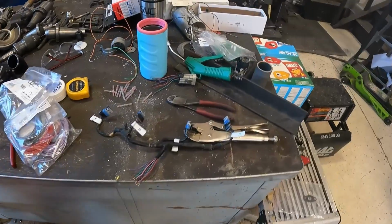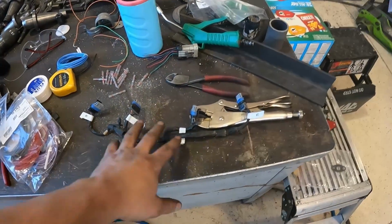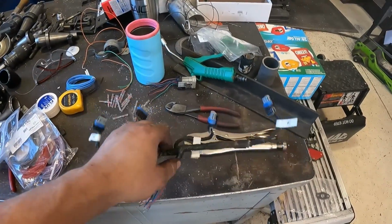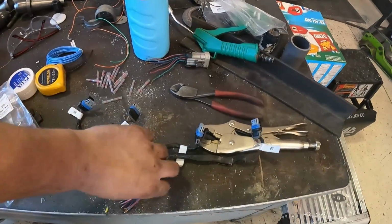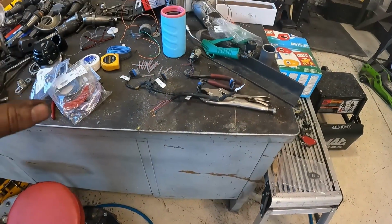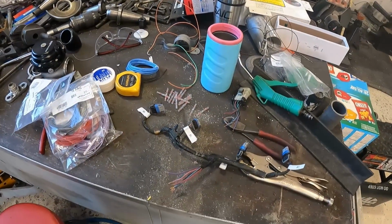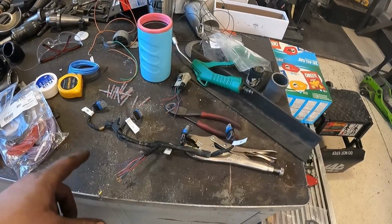Little bit of a tech tip when you're doing a kind of sloppy coil relocation. Just snapping these back on, if you flipped the brackets, will end up with your firing order incorrect. So we labeled these, so we plug them in the correct direction. So I don't have to repin the harness on the top side. All we got to do is extend this about 9 inches. Everything hooks up. So I'm building this just quick with these aircraft heat shrink deals we used before. They seem to be working awesome, and just fire coils. So it should all be good.